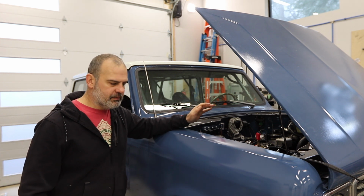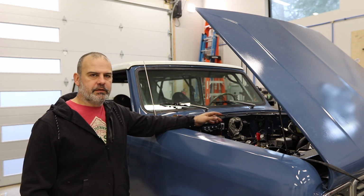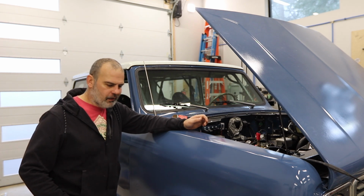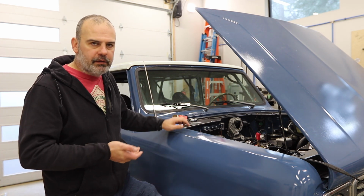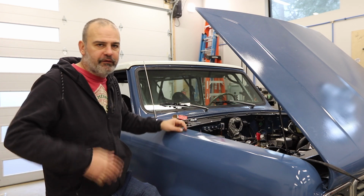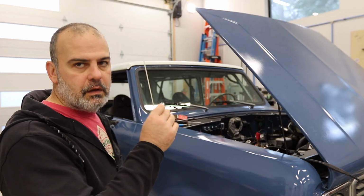That's usually a symptom of a vacuum leak, but I know there's no vacuum leaks in any of the usual suspect places, meaning the hoses and connections and all that, and the throttle body, like underneath the throttle and between the throttle and the manifold. What if I don't have a vacuum leak? How can I have a vacuum leak? And I started thinking about the controlled vacuum leaks, which brought me to the PCV valves.